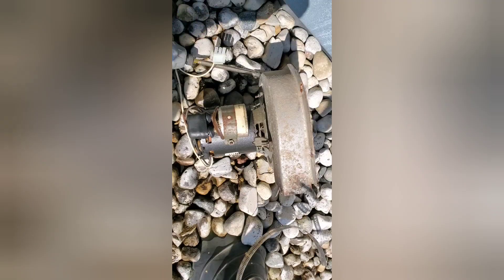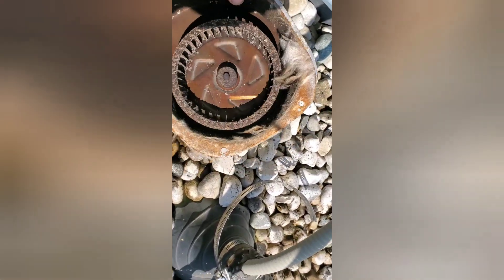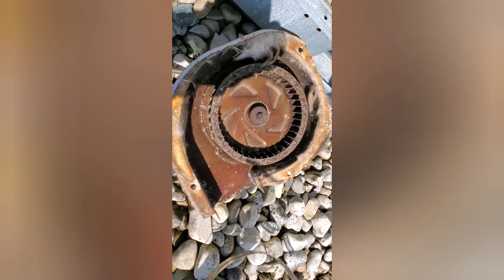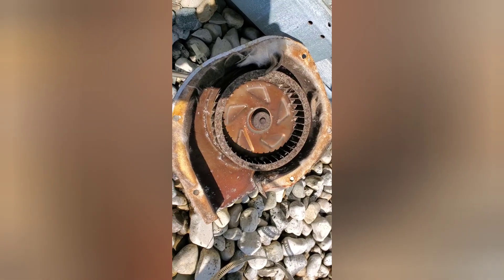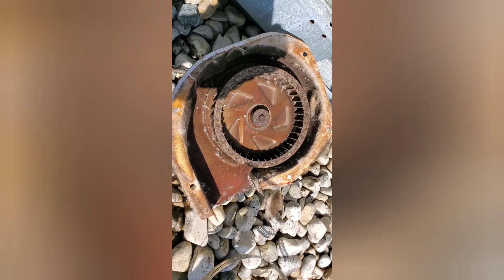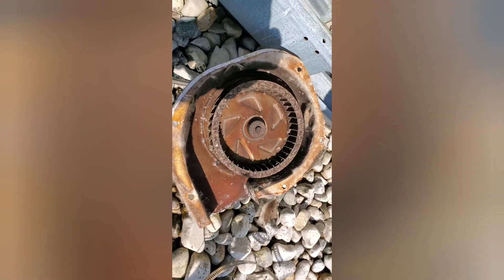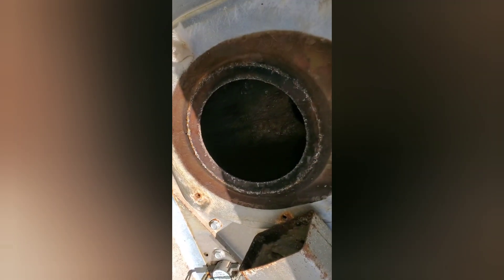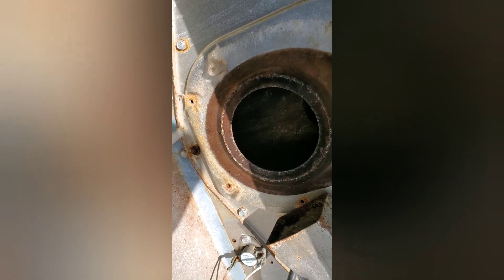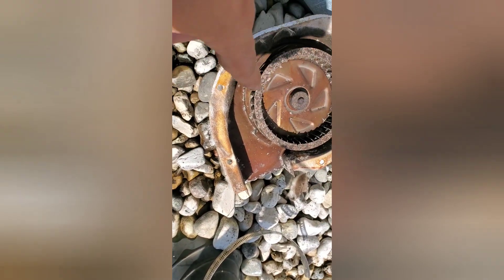I have opened up the motor housing. This is the motor — let's give it a good spin. See, the bearings of the motor are gone. It's making a very loud noise — it's completely gone. The motor is totally black; maybe it was running a little low on the spec RPM, and that's why there's this black soot buildup.